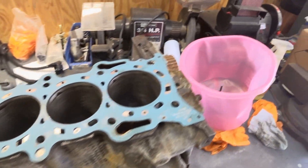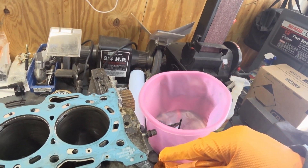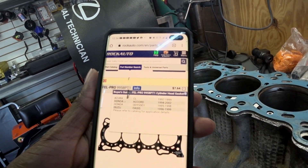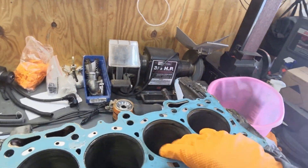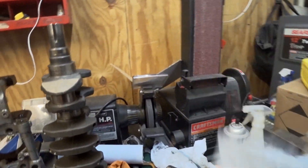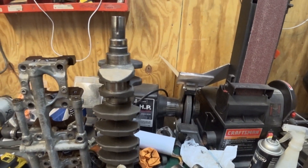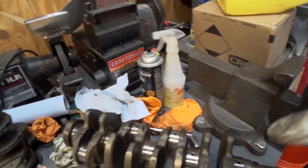This is an F22B1 block. There's a Fel-Pro gasket that came with it — checked it and the Rock Auto order is for a '94 to 2000 Accord, covers a 2.2 to 2.3 cylinder. Everything seemed to line up fairly decent. Block is pretty clean, still got a few final touches but it's better than it was. Now here's my issue: I have an F22 crank but I'm not using that one. I'm using the H22A crank — that one should give me the compression ratio I want. Dropping this off at the machine shop tomorrow to get cleaned up.